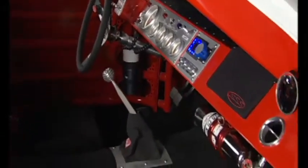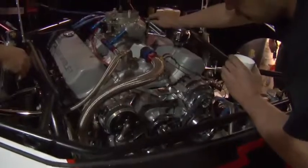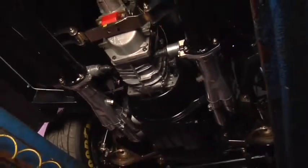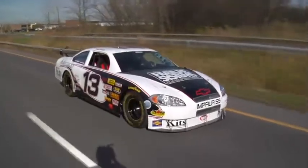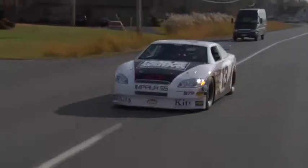Because of the horsepower of this engine, 620 horse, 650 foot-pounds of torque, we felt it best to put a heavy-duty clutch to it, so that the clutch isn't going to wear out and have any slippage. It's actually a 2,400-pound clutch, which is about the maximum you can go on a street-driven car without getting clutch chatter and things that would really not be fun in normal driving.